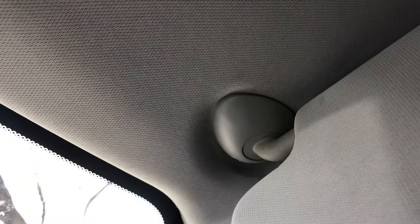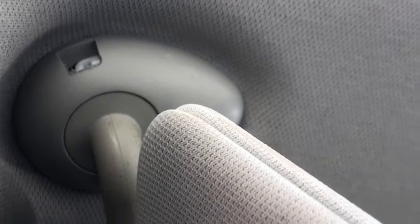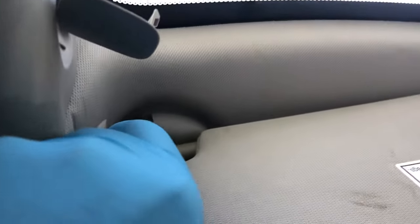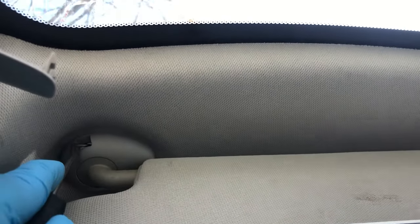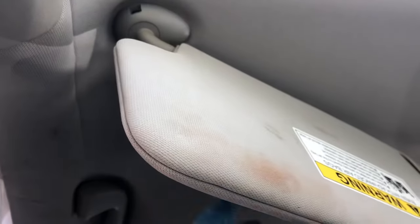This other one is a little harder to take out. As you can see right there, there's a white towel. You push the tab and move to the right, then pull down the sun visor. Put the sun visor in this position, push it right there with an ice pick driver, move to the right — as you can see everything is moving. After you push it, move to the right and then pull down.